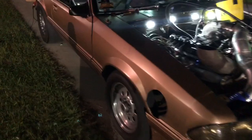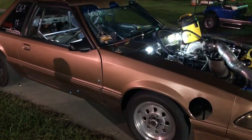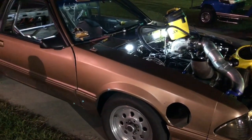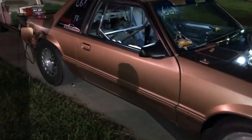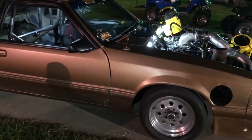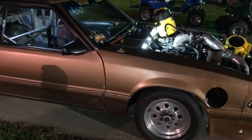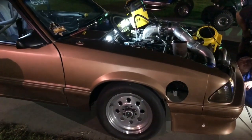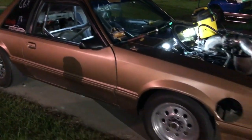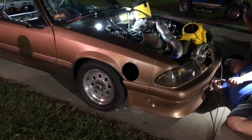The thing I don't understand is the wastegate is not stuck. I've got a couple data logs where I say it's 30 pounds of dome pressure, makes dead on 30 pounds of boost. And that pass, I knew I needed to go a little faster, so I had 35 pounds of dome pressure, so it should make 35 pounds. It made 40, so it's not bad off. Tune-up's fine, tune-up's great. I'm not scared of 40 pounds of boost. I'm not scared of 45 pounds of boost. I don't necessarily want it there, but it needed to be there on that pass against Shannon.